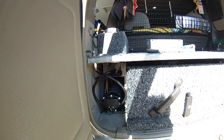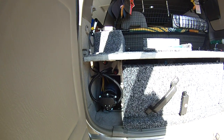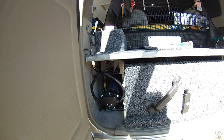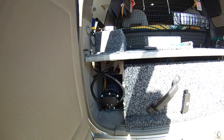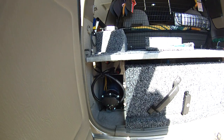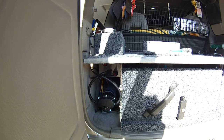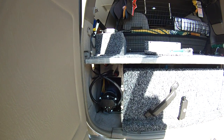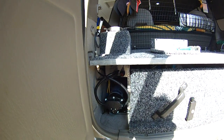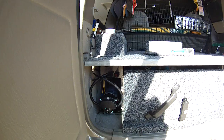The setup here at the back is a tank that I had fabricated myself. That's a Devil's Own pump, and now that I've gone pre-turbo I've had to purchase some other bits and mixed and matched some bits. I wasn't convinced that the Devil's Own unit had enough safety to run the pre-turbo injection — I'd heard of a couple of failures and I just wasn't happy with it from a safety aspect.